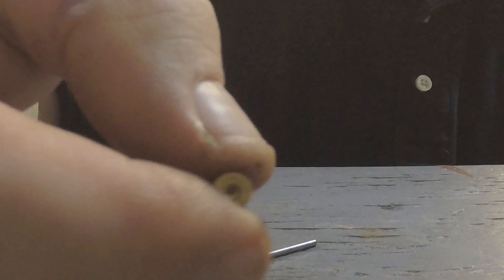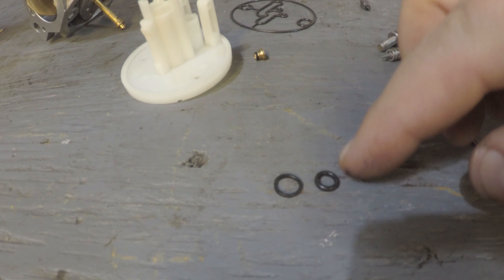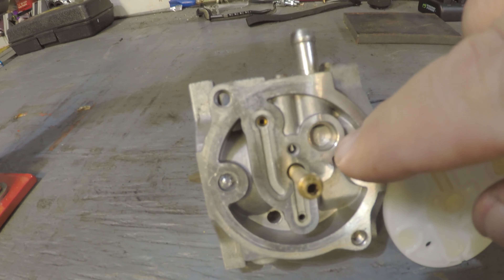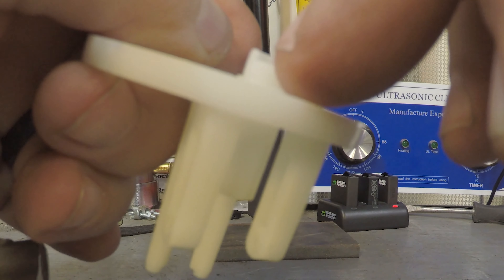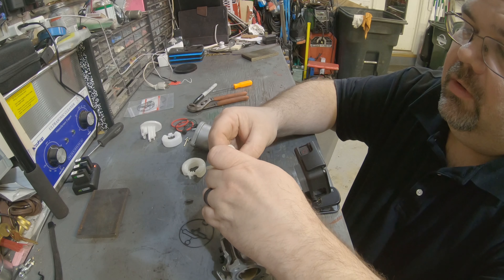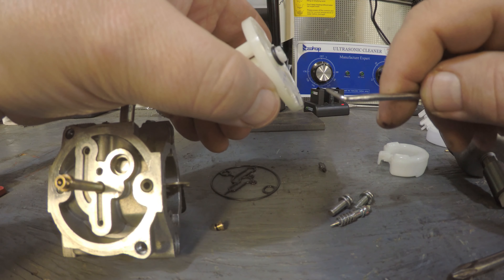This is the o-ring I took out — you can see it's stretched and flat; sometimes they're torn or ripped. This is the new one. When you put it back together, put the o-ring on the jet first. Don't try to stick it up in the hole and then force the jet in, because you can damage it that way. Put the o-ring on here — there is a low side on this — so start it on one of those sides and walk it around. It'll be a tight fit; just use the side of a screwdriver and slide it down on there.